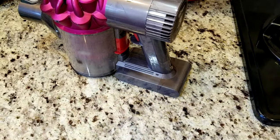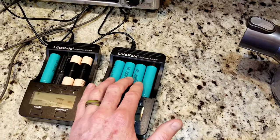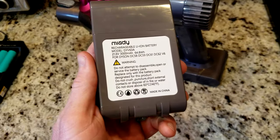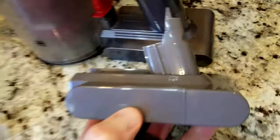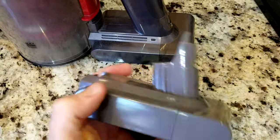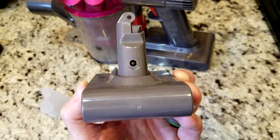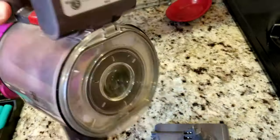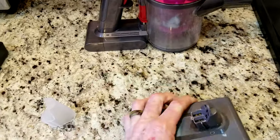If you're really handy DIY, you can take apart the battery pack and re-spot weld in a new 18650 cell. These are the same cells as in a Tesla car battery pack, but the easiest thing to do is just purchase a battery. This is actually a third-party one, not a Dyson genuine, but these are the model numbers it's for. It has an LED indicator light and good reviews. This one is actually upgraded to 3,000 milliamp 64.8 WH using higher-capacity batteries, while the original is at 2,100 milliamp 46, so this should last longer than the original battery pack.